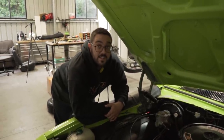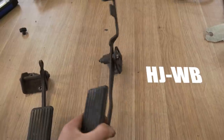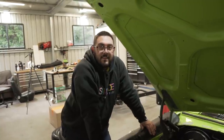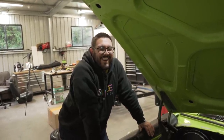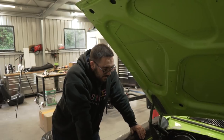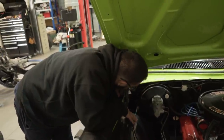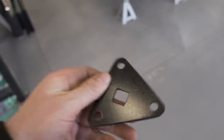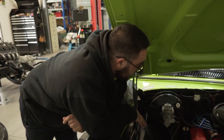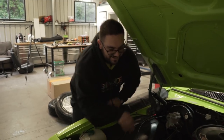The reason being is that HQ brackets for accelerators are different to HJ and above. So I was either going to make my own bracket or I just ended up stealing one off my panel van — so that's got no accelerator at the minute because it donated its services to this build. I also had to make up a triangle plate with a square hole for where the accelerator cable comes out — it looks really nice and it's going to work. Under the dash is pretty much finished.